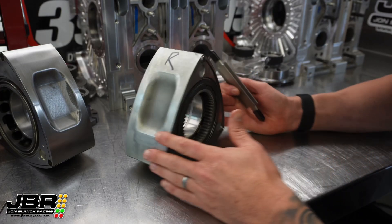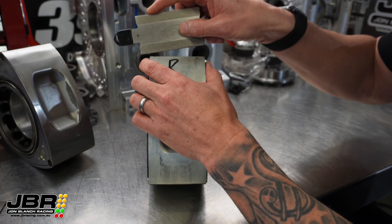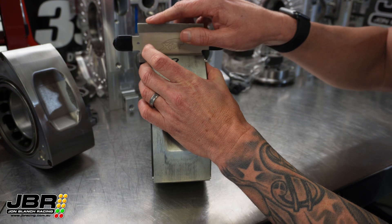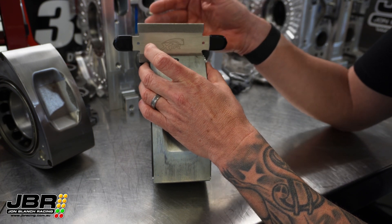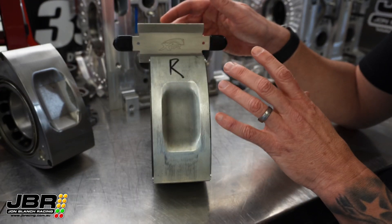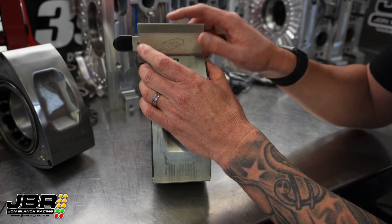Just to show you how I do it — once the rotor is assembled with the corner seals in place and side seals all done, exactly as it'll go into the engine, you grab the file and drop it in there. Hold onto the corner seals so they don't slide out, and just do a couple of passes backwards and forwards. You don't need to get carried away — you're not trying to make the groove any bigger. All you want is to make sure the groove is nice and smooth, the file passes easily through, and all the seals and grooves are perfectly aligned. This process will eliminate any discrepancies in the alignment of the corner seal groove to the apex seal groove, or if the slot in the corner seal isn't perfectly centered.